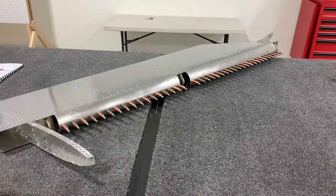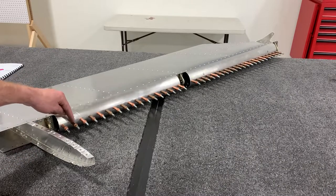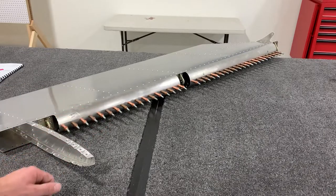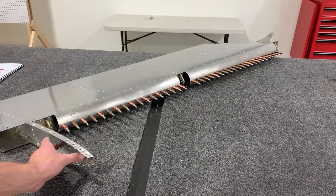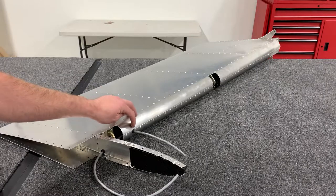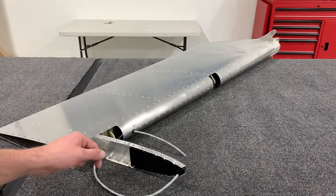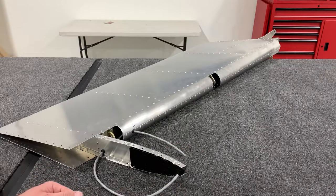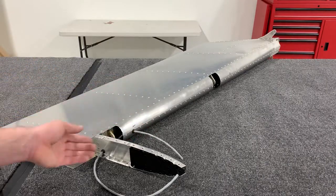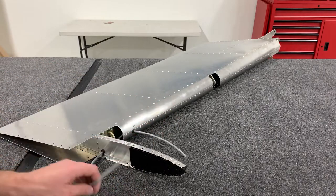Once both sides of the skins are completely riveted down, rivet the front set of rivets for the overlapping skins. Keep in mind that the second rivet hole down will be enlarged to accept the tail strobe wire grommet. Upsize that second hole to 3/8ths inch in the US, or 9.5 millimeters. You can use a step drill or multiple sized drill bits, slowly working the hole size up to 3/8ths. Then put your grommets in and run the wire through with soapy water, leaving enough length on each end for the connector as well as wiring your tail strobe.